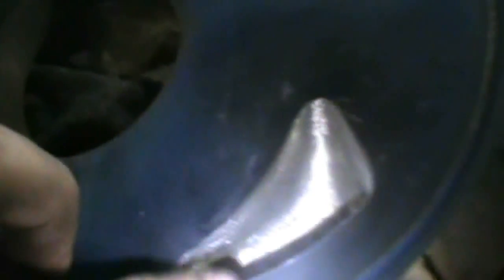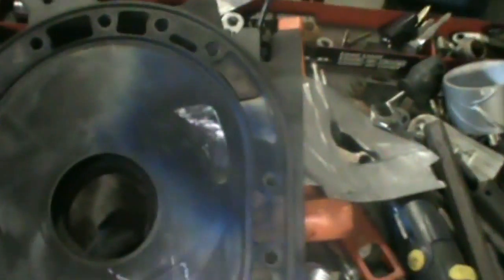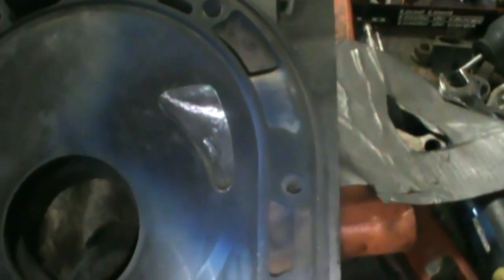I got the timing lines all pretty much ground in and blended pretty good. You can see around there - it just needs a little bit of blending and then I'm going to hit it with the sanding wheels and get it all smooth. This one's pretty much done. At the beginning of the next video I'll show you what it looks like once it's all finished and polished up. I'm gonna do this one on my own time and then start on my rotor housing - got the marks all put in there. This is probably going to be about it for part 8 of how to rebuild and port a rotary engine.